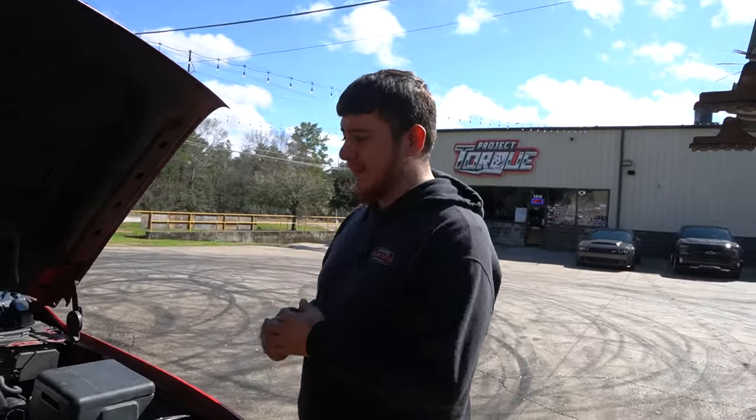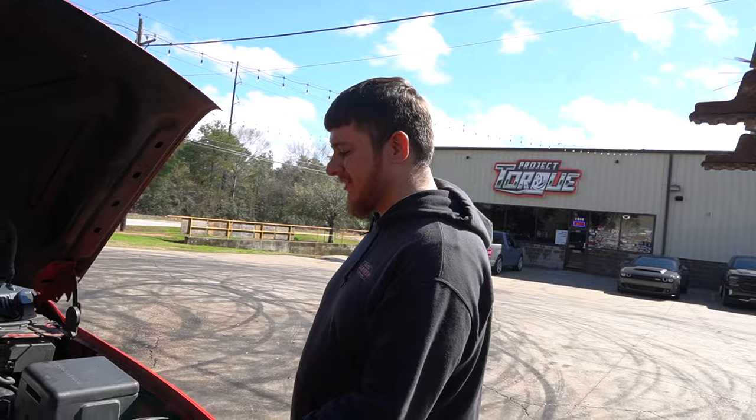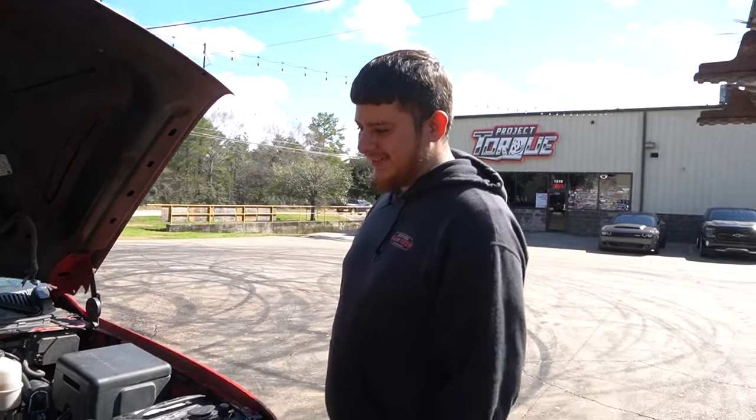That's the thing, guys. A lot of these older trucks are either flex fuel or they're 93. You can hop back and forth between the two. That's why we say flex fuel, because you can take both. This can run on 93 and E85. He can pump whatever he feels like, but obviously with 93, it's going to be less power, but it can do it.